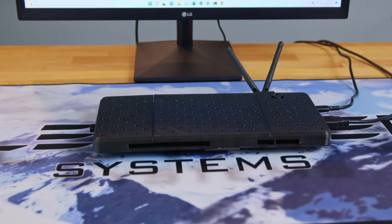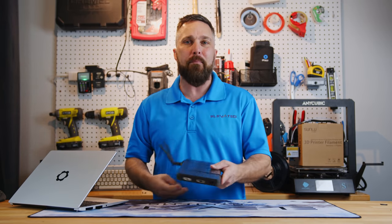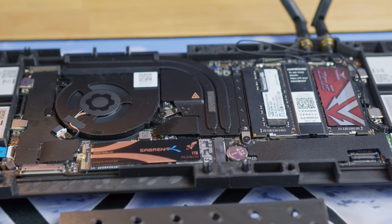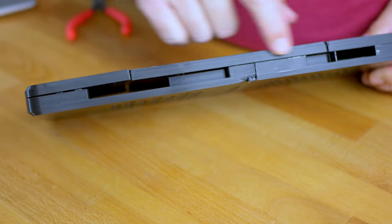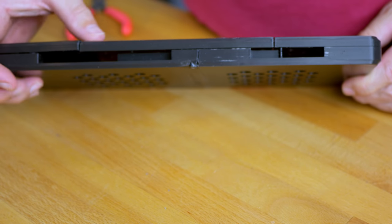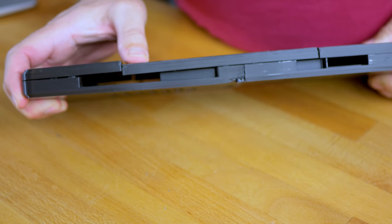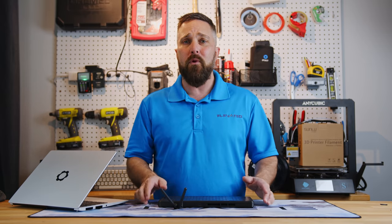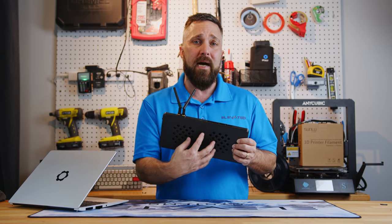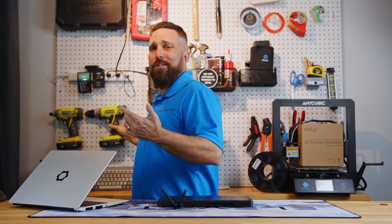I'm adding the feet from my CJ64 case - mounted with double-sided tape - but this could be easily modified to add feet that pop into holes on the bottom. You're definitely going to need to prop the case up. There are also cutouts on the bottom that line up with the battery connector and touchpad cable connector, which is good for future expansion but makes the middle cover a little awkward. The only other improvement would be the inclusion of VESA mounting holes on the bottom so it can be mounted to a monitor.